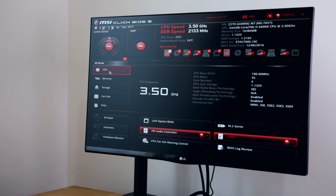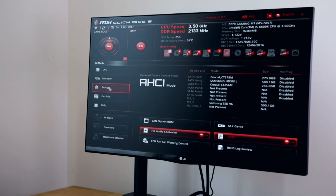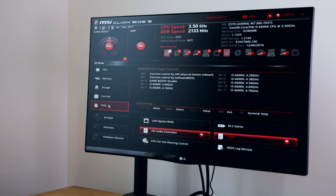The last thing about a motherboard that makes it unique and different to others is its BIOS. These days, all the BIOSes from the different manufacturers — MSI, ASUS, Gigabyte, ASRock, EVGA — are generally pretty good. We have the UEFI BIOSes now. Different BIOSes allow for different settings and you can change some advanced things, or just tweak the basics. A good BIOS, in my opinion, is nicely and easily laid out, explains clearly what the different things do, and shows your current system and how it's behaving without you needing to go out of your way.